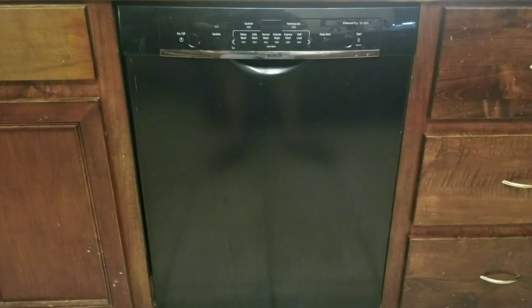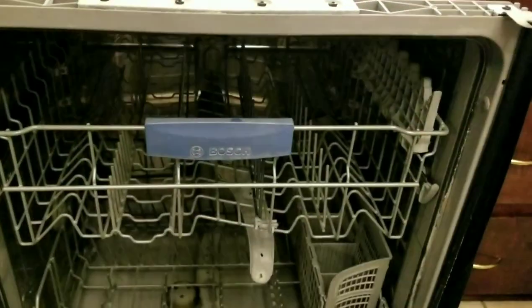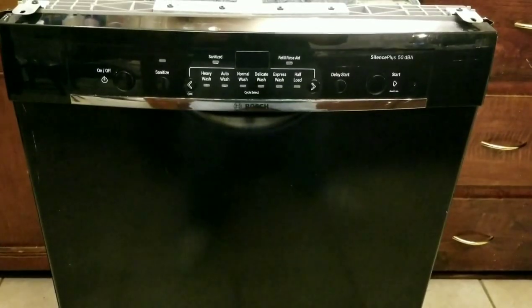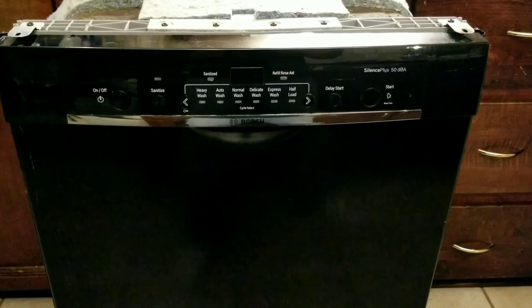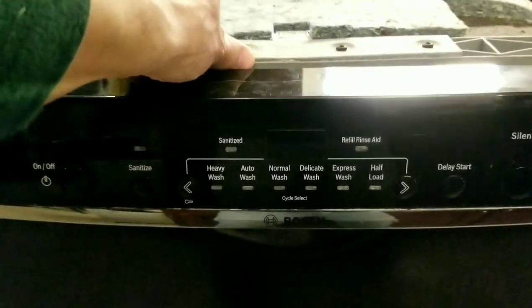Be careful when unscrewing it from the cabinet. The issue is often solved by opening the door during the cycle, reclosing it and pushing firmly, and then the cycle picks up where it left off — or sometimes it'll jump back about 20 or 30 minutes and then actually finish. The problem is related to the door latch up at the top, not sensing that the door is actually shut.